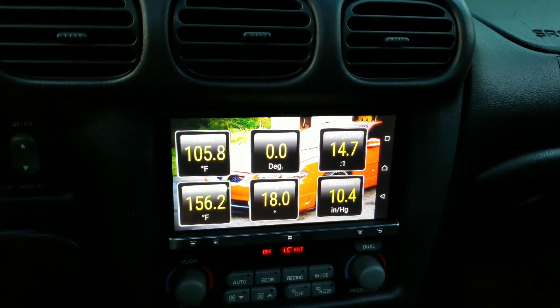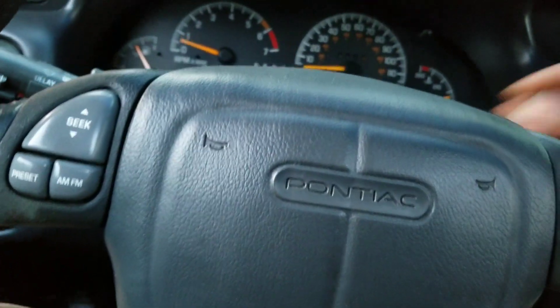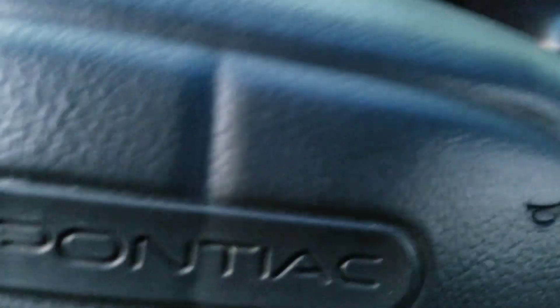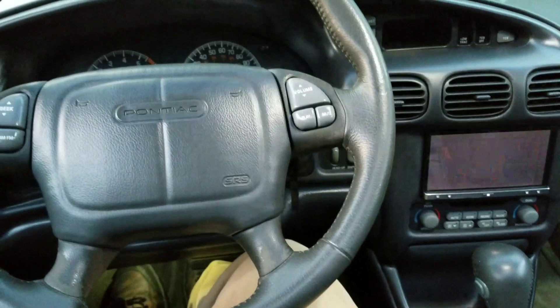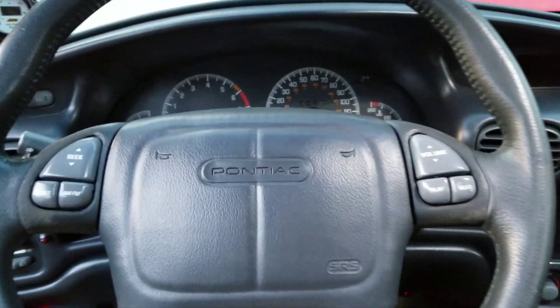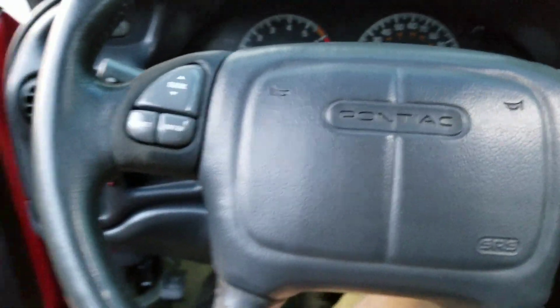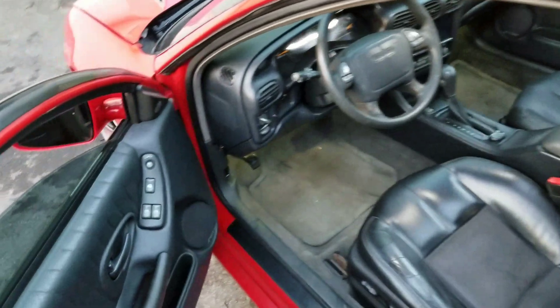I'll shut that off — waking the neighborhood up. This car has the IS4 cam, IS4 heads, ZZP headers, 2.5 pulley, Sony 85, 80-pound injectors, ZZP fuel logs, North Star. I'll just pop the hood because it'll make it easier to explain.